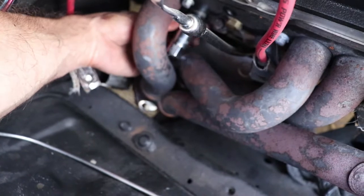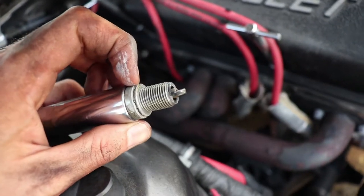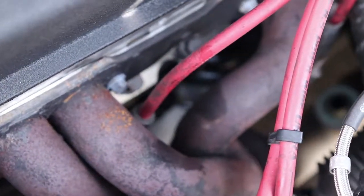Basically I'm an idiot — I tried starting the car because I figured since it's no longer leaking into the fuel bowls we should be okay. I wasn't thinking that it had just dumped a ton of fuel into the cylinders. I tried cranking and it went really hard — I popped my 100 amp breaker because it's pretty much hydrolocked. So now I get the joy of pulling all my spark plugs to try to drain the fuel out. Hopefully nothing is too messed up, hopefully I didn't damage a ring or something. Wish me luck.